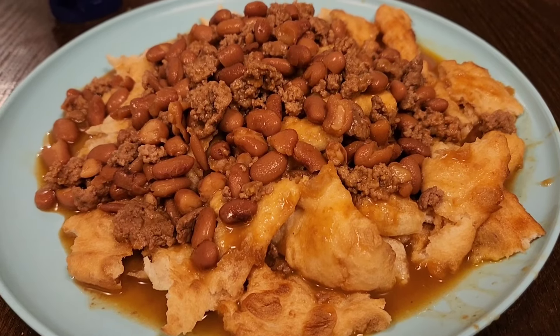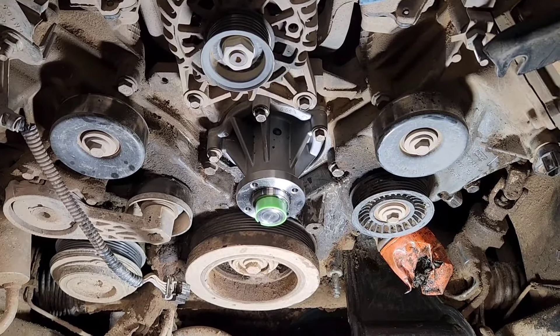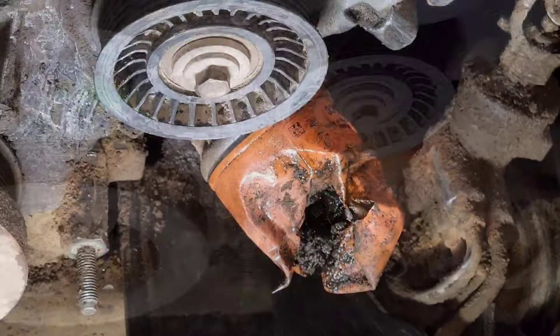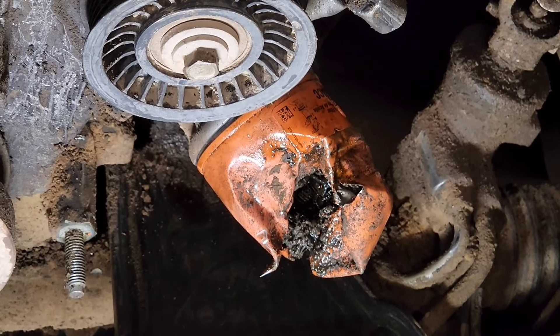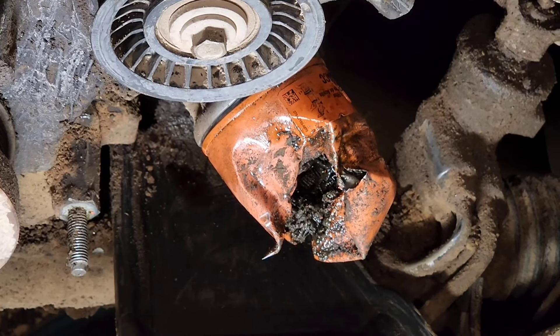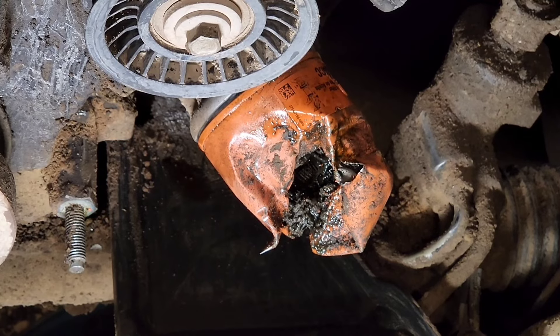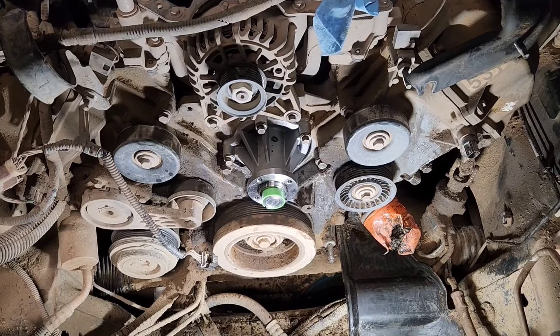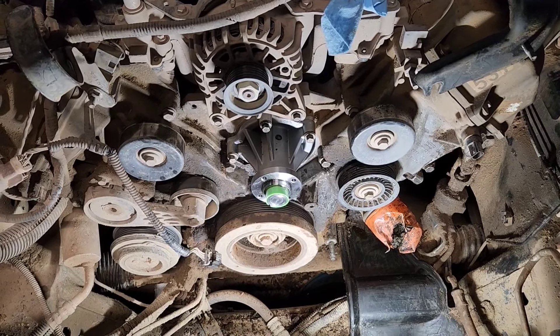Mama said that the food is done, so I'm going to wash up so I can eat. Some Navajo tacos for dinner. Thank you Mama. You're welcome. I love you. I love you too. The new water pump is in. I had to get that oil filter off — it was a little bit of a pain. That thing was put on dry a lot of miles ago, so that rubber seal was baked on there. I got it loose and I put it back on for now. Tomorrow I'm going to put the power steering pump on and put a new oil filter on it. It is 10 o'clock, so I'm going to go inside and work on some editing and spend some time with the boys and Mama Bear before we crash out.